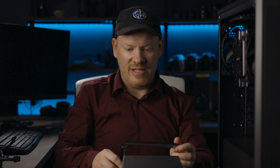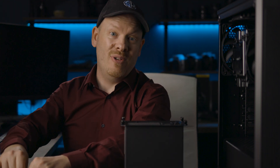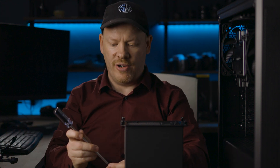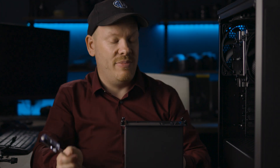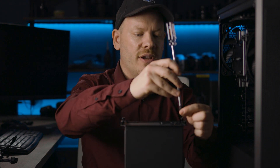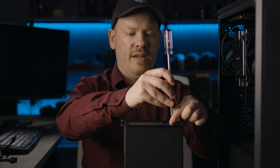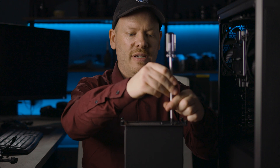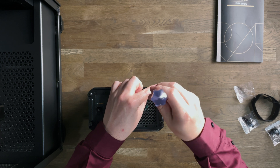You don't have to suck the insides out — you can just pull off one of the meshes, like this top one here, and just hoover that up. Same as the motherboard, it takes a few seconds to double check. Saves you a lot of hassle, because if you use the wrong screw size on something — let's say a hard drive, for instance — and this is from real world experience, over time that screw is going to work its way loose and find its way onto the motherboard. I don't need to tell you what a loose screw inside a computer can do to your hardware. So don't ever be embarrassed to look at the manual.